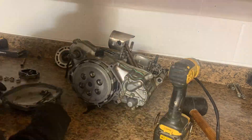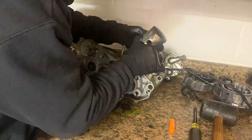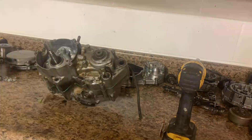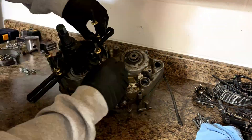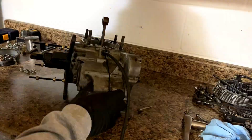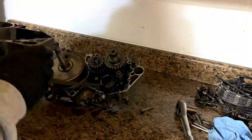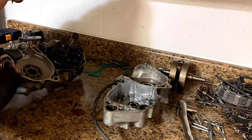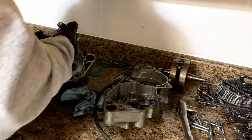Right away as I'm stripping this down, I notice that the piston, rings, and cylinder are good — thank god the cylinder is in good shape. But it also looks like it wasn't done very well. When the cases were split, there were a bunch of pry marks from a screwdriver, and there's so much carbon buildup in the exhaust port linkages. The oil even looks super dirty. Taking it apart made me realize the main bearings, even though the crank was replaced, still felt a little iffy. So I'm happy I did all this — it's worth the effort.